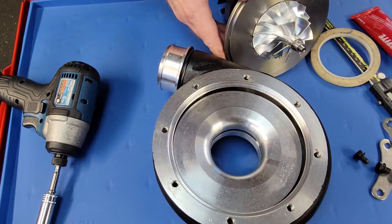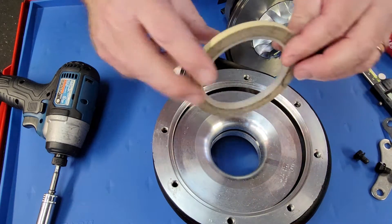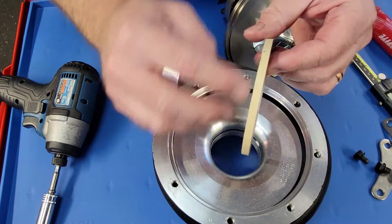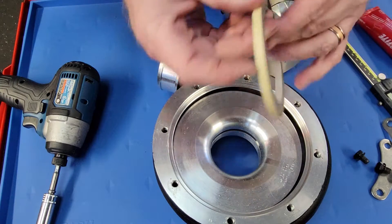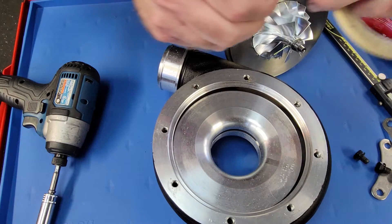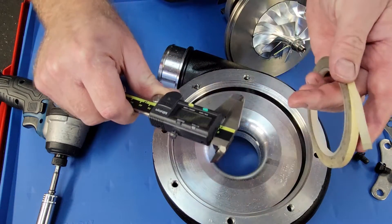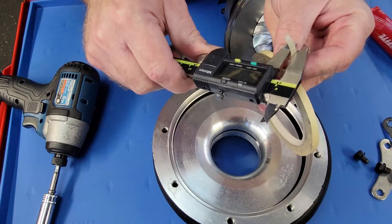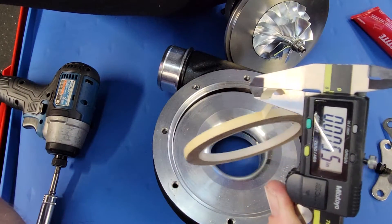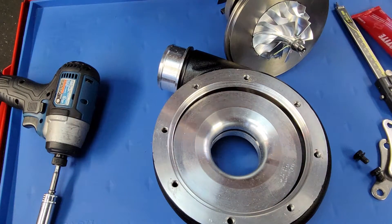This is going to be the simplest thing you're ever going to see. Go grab some scotch brown masking tape — this just so happens to be quarter inch wide. If you only have wider, go ahead and tear or cut it into quarter inch wide strips. The reason why we want to use this: you don't want to use blue painters tape, green tape, or any of that fancy stuff — just regular old plain brown tape. If you grab your calipers and measure the nominal thickness of it, it's basically five and a half thousandths.